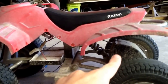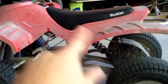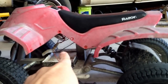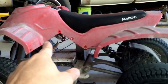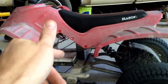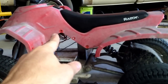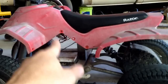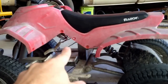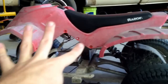I've done some reading and a lot of people have switched these to 36 volt — the motor does fine, they say. You normally burn up the controller when you do it, and if you swap to 36 volt without a proper controller, you have a charging problem. You've got to pretty much take the batteries out or isolate them and charge them individually, because you can't charge through the controller anymore. I already have a 36 volt charger, so when I convert this with the 36 volt controller, I'll be able to charge all the batteries together.